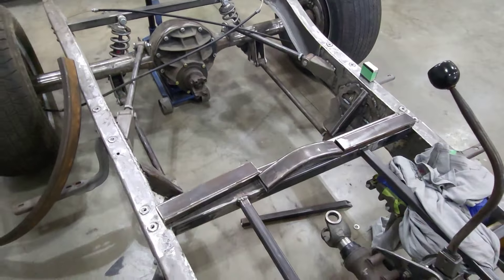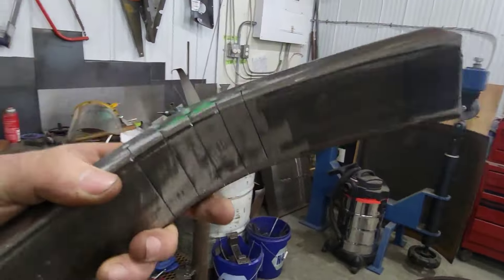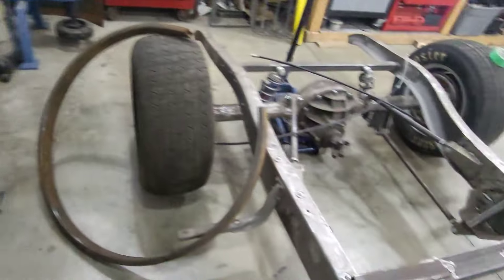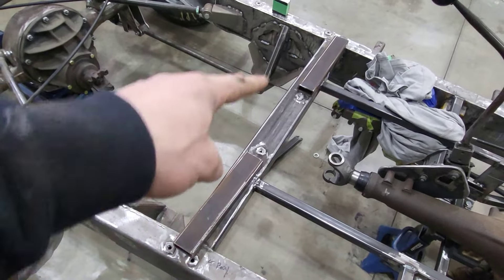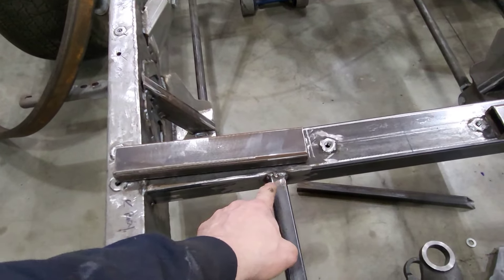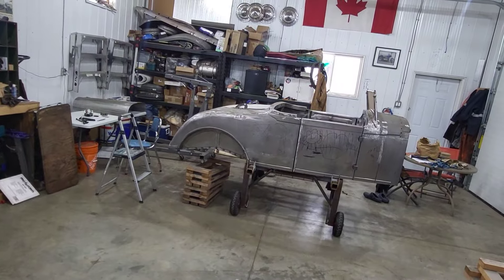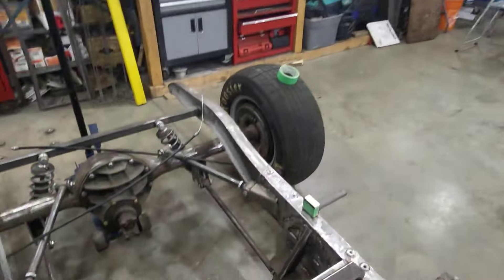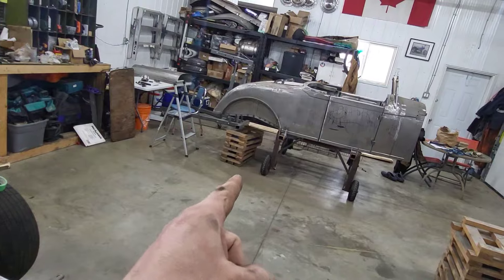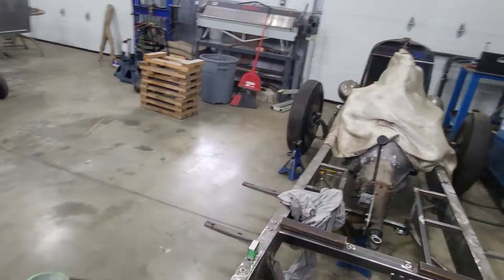Next I'm going to finish welding these little slits I made to get a little more arc, then cut that big piece out. I'll have this piece tacked in, get the final measurements, put the new piece in, and weld it back in. The existing flange nuts I had in there for the floor piece on the body — when we put the body back on we'll just have to line those back up, make some holes, and figure that out. I've got to cut a few pieces out of the floor anyway to match up what I'm doing here.